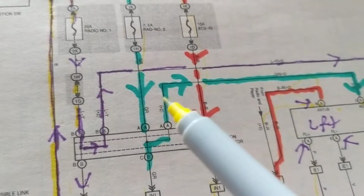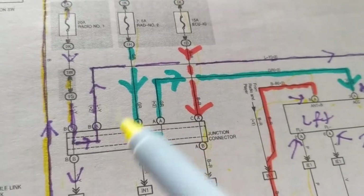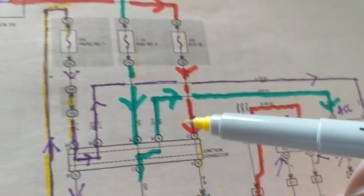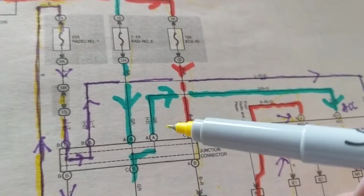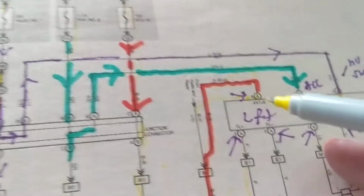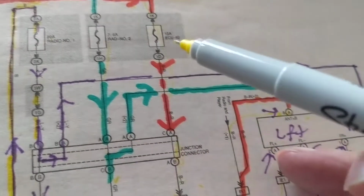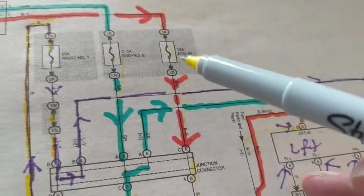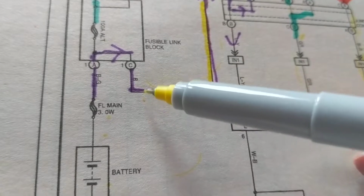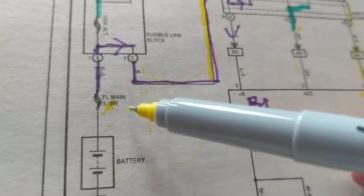However, again, in hard wiring, wherever that wire lands, you are surrounded by chassis ground. Engine block is ground, alternator, everything is ground. That's why I made a video: you always put the negative last and you take it out first. Everything is negative, therefore you can't blow a fuse. If this wire broke off and it touches ground, it'll blow this fuse. If the wire broke off and it touches ground over here, it'll blow this one. If over here, this wire broke off, it touches ground, boom, it'll melt this fusible link.